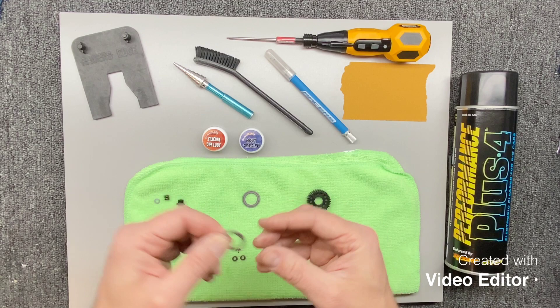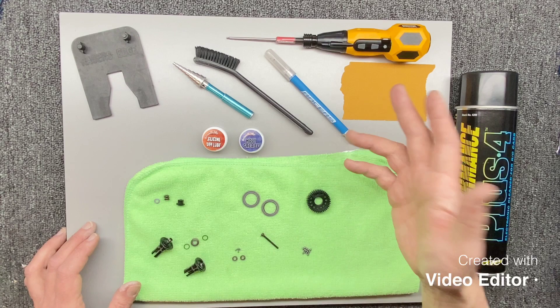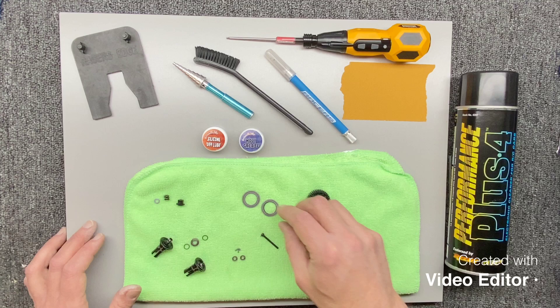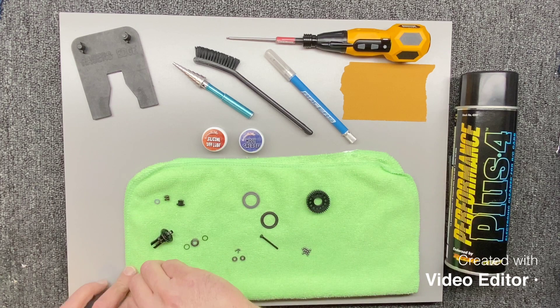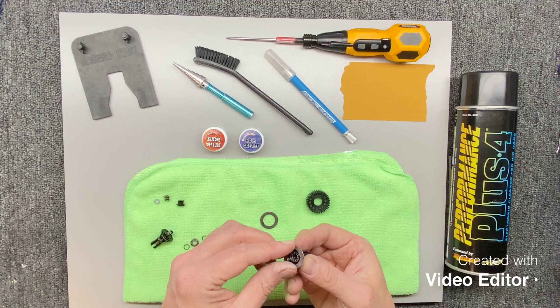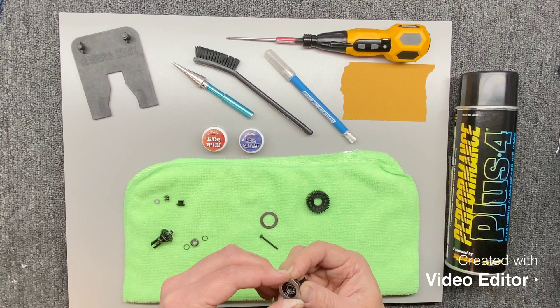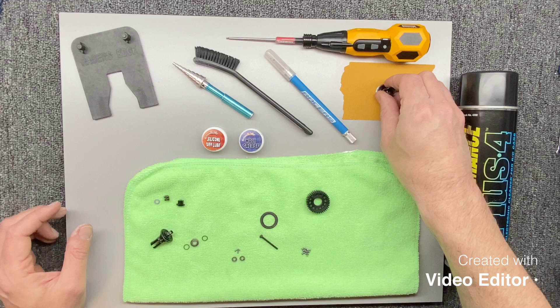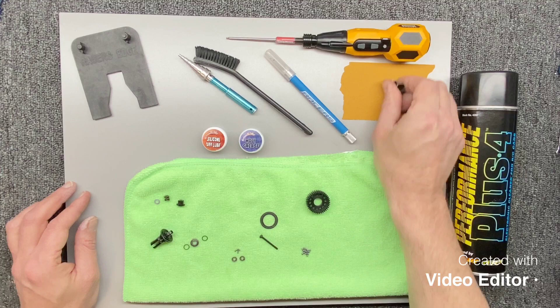What I'll do is have my setup board fairly flat and stick down some sandpaper — this is 220. You can go finer if you want. I also have a glass setup board because glass is obviously perfectly flat, but this will be fine. I'll take the out drive that's flat with no tip on it and sand the ring using that side of the out drive to hold the ring. There are companies that make kits for doing this but you don't really need them — you have everything you need right here. I'll just take it and put it on — it seems pretty rough at first but it's not too bad. Just even pressure, not pushing down super hard.